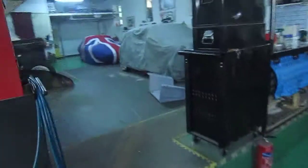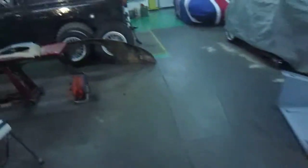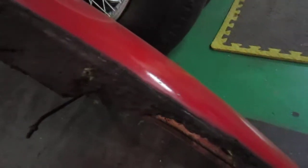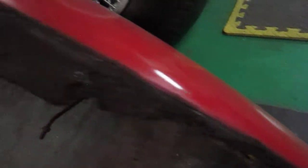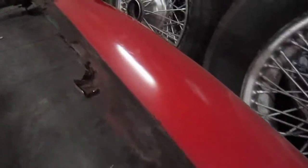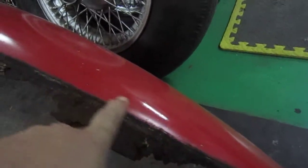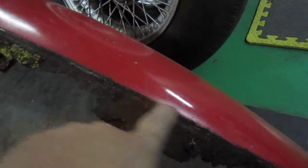But on the other one, I'll show you, it's quite bad. It's going to need an extensive return edge — you can see it's completely gone there, it's right over. You can see it's fairly bad all the way up. So what we'll do is sandblast this one tomorrow, but we'll just sandblast the area where we're going to cut it. There's no point sandblasting this obviously. Just sandblast it back a little bit on that edge.